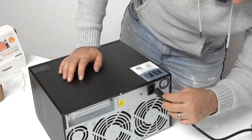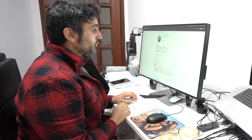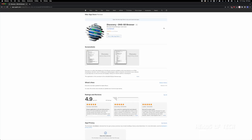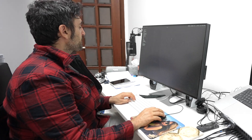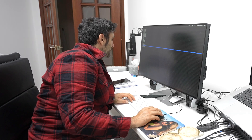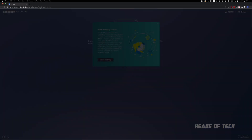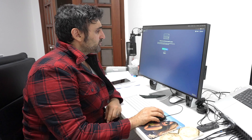You also get the slowest Cat5e cable — don't use this cable, it's going to make everything slow. Get a Cat 6 cable and you'll be good. It's actually been a few weeks since my unboxing video because I noticed a strange sound coming from the power supply, so I hit up support and requested a replacement unit. Now it's turned on — I heard the beep. I'm using a Mac app called Discovery to find the IP address allocated: 192.168.1.232.